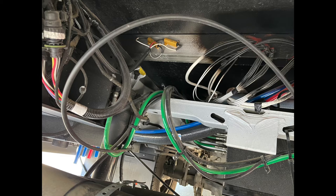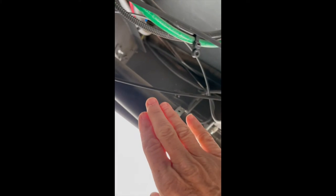The rule is not to have more than a 180-degree turn, and obviously no twisting. We went ahead and had the warranty cover it — they replaced both valves and the lines. Now, this is the after installation. They're much sturdier at the beginning and the end. The line goes fairly straight across; the other one has a little curve but nothing like the twisted mess before. It was literally more than the recommended 24 inches between end to end if bent at all. Now they work pretty well.